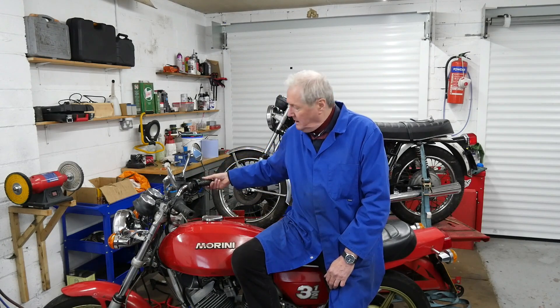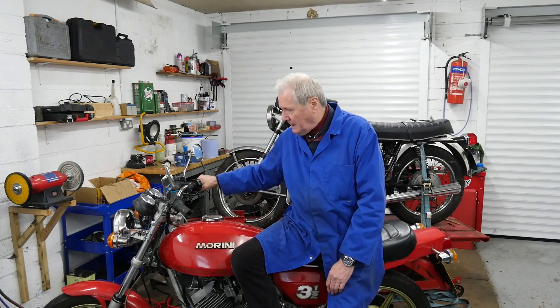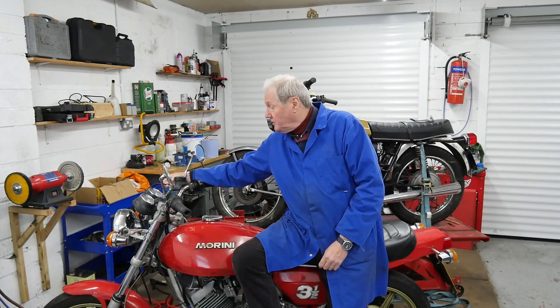One thing I noticed when riding: on the throttle, this first part it does return - so it's on the throttle spring or springs, because there's two - and it does raise the RPM. But then it goes a lot tighter, and I'm wondering whether it's picking one carburetor up there so they're never in sync. My first job is to remove the tank because it's easier to see the carburetors. I'm going to check the cables - it's a twin-pull twist grip with two separate cables, not one going to a splitter. Join me in a minute when I'm down to the nuts and bolts.